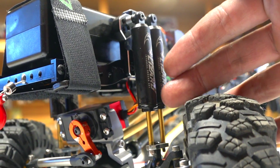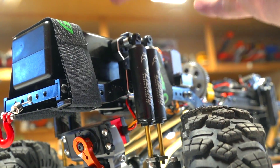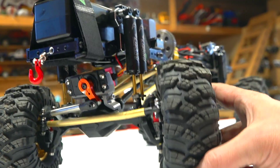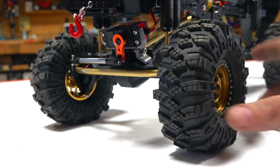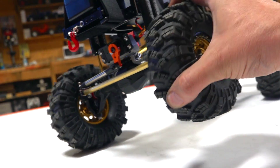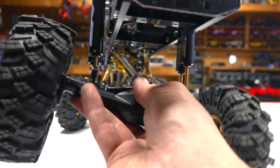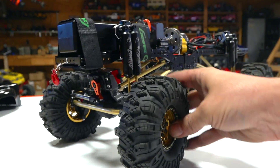Here it is on the front, same kind of idea. The springs are on the inside, but I also did do the outside. That's just for my own preference. Because I am running a three-cell, 5,000 milliamp, hard case, pretty heavy LiPo battery, plus I also have got my winch servo back here, I don't want this to be a wimpy loose front end. I like having flex in the front, and you can see that there is quite a bit of suspension flex in the front. But when I'm going over a hole, I don't want my front end to fall into the hole and cause my whole truck to roll in. I like to be able to drive on one side and float my front over that gap. But look in the back — completely different. Here it is on the staggered suspension — because I'm going basically only sprung with one of the light springs in the back, all of those shocks are working.